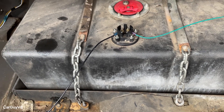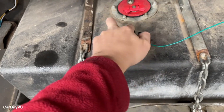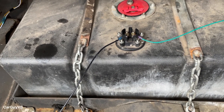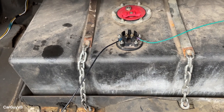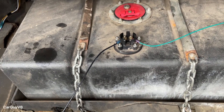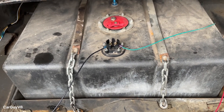If you want to make sure you get the right gauge the first try, take out those five bolts and pull the sending unit out — super easy. That will hopefully have a part number on the sending unit, and you'll be able to look it up and see what ohm range it uses. Or if you buy a brand new one you should know already — it should say in the description. But I should have done that first. I didn't, so now I've got two fuel gauges.